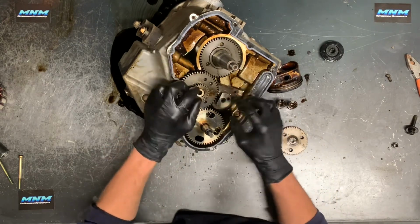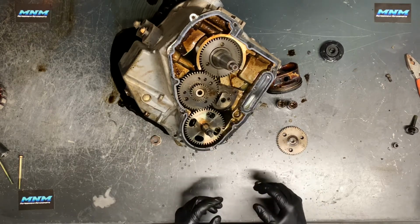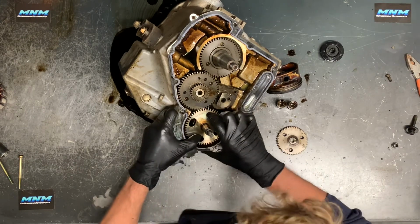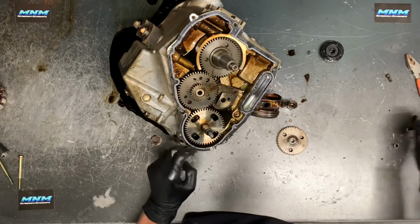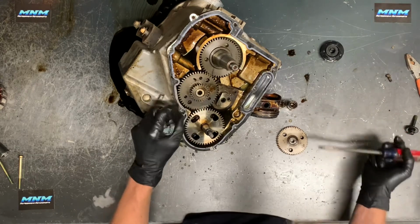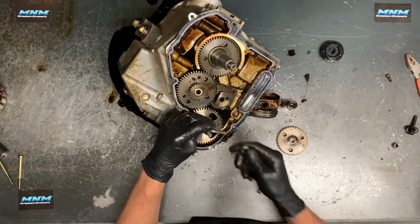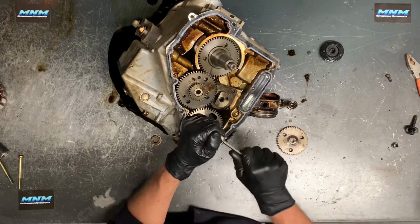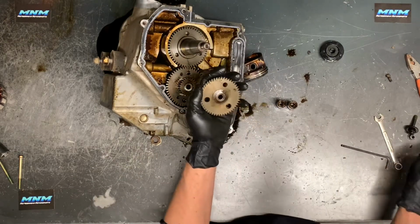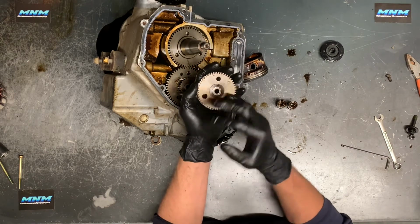Now that we have that bolt off of there, we can actually pull our oil pump off. We've got Allen bolts down in here that we'll need to remove, and they are just underneath of these gear holes. So get these gear holes in the right position there, and you should be able to do them all four at once. So if you need to, take your screwdriver, turn that over. Most of the time you can use your motor to turn that over. Okay, this one right here, we're going to do the old Tyson wrench trick here. Now, going back together, and I've showed you this in my rebuild videos, but I like to take something, stick it in there, a bolt the exact same size as that, and that'll straighten out that gear.